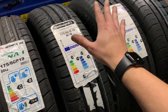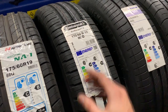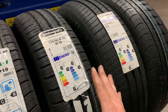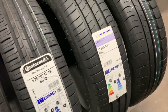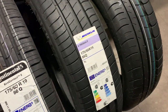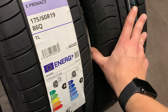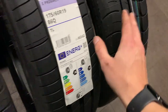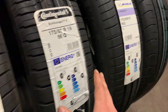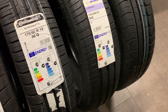The Michelin and Continental really give the best of both worlds — you get good levels of tread, around six millimeters across the board for the Continental, a touch more than that. And it's a very smooth, much softer ride. I can only imagine it's because you've physically got more rubber between you and the ground. Obviously sidewalls come into that, and even pushing into the Ecopia sidewall, it's a lot softer. So maybe the additional rigidity of the Michelin and the Continental help give that softer and quieter ride as well.